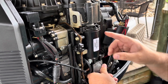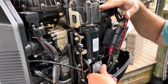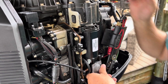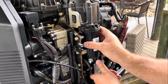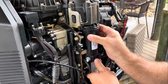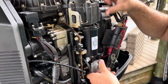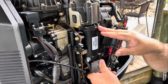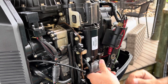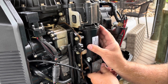Okay, so obviously I had to wash my hands to get my clothes out of the washer. Anyway, here's the part that you want to pay attention to. So that Bendix is on a spring in here, and I'm not sure without looking at it exactly what is happening in here, but you can't just force this thing up in there. You got to kind of wiggle it and play with it. There. I don't know if you heard that. It was like a slide. Don't force this. You could bend the Bendix and then you're screwed. You have to remove this and replace the Bendix. So I'm not gonna take it out again because it's a pain, but whoop, there we go.